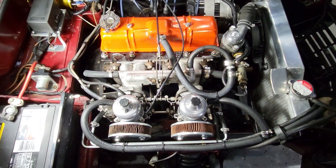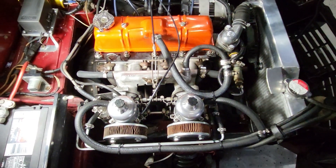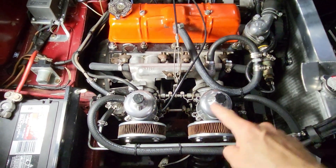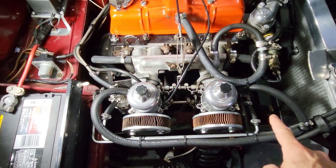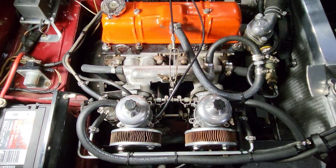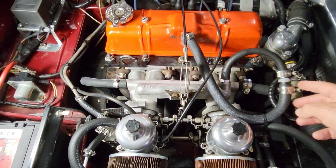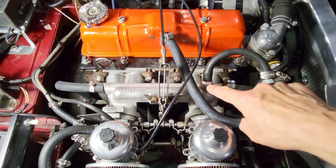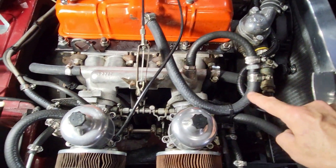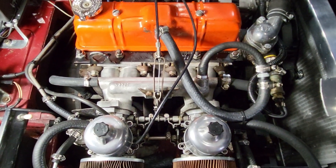So I came up with two different solutions, and the reason for the second one is the first one didn't work. So here's the second solution. What I ended up doing is basically separating the carburetor vacuum lines from the vacuum line that I've created using the tap off of the intake manifold. I've put in this line — this is just the prototype, I'm going to pretty this up a little bit later. I've got the tap here, I've put a PCV valve in, and then right directly to the crankcase.